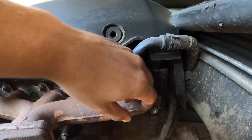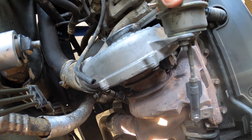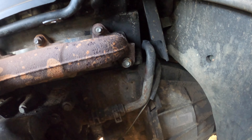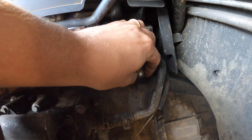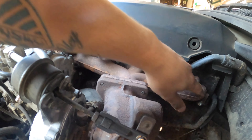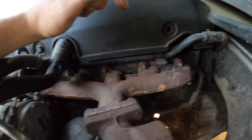When I did the turbo check - internals are fine, waste gate working all right, that's moving, everything's doing exactly what it should. But I mentioned this high-pitched whistle when you put your foot down. If you've got that problem, it could well be this. This back nut here - I can actually turn it all the way around, it's nearly vibrating all the way off. The rest of them are all right, I've checked them. It is a common problem for either this end to go or that end. A lot of people de-web them.